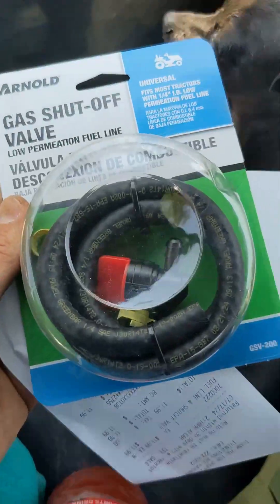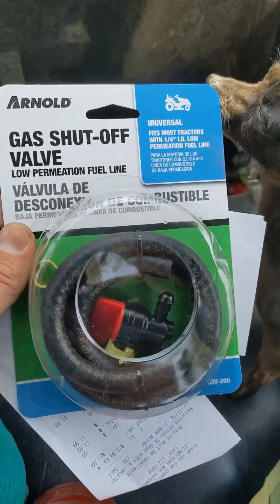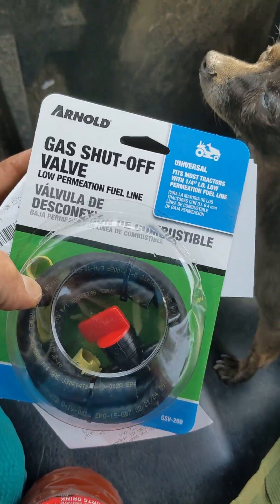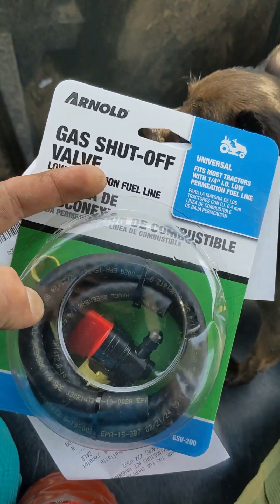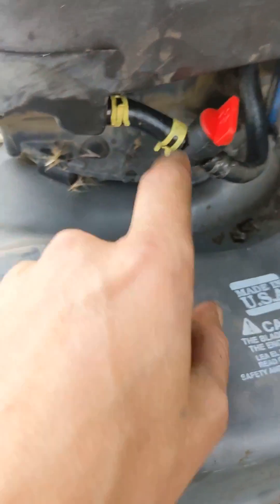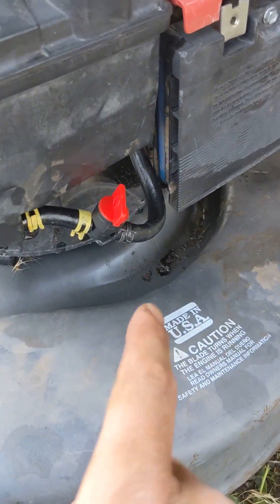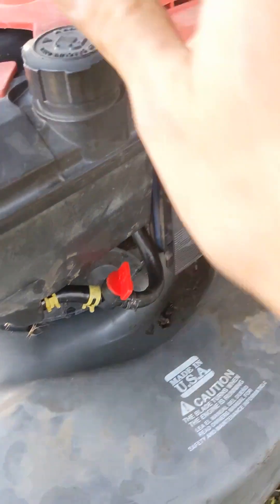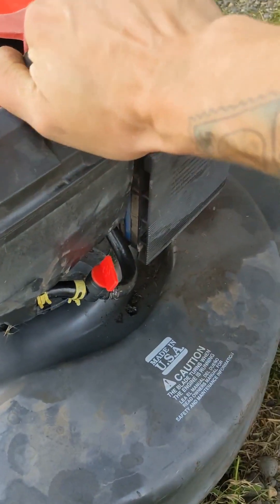I actually ran that lawnmower for quite a bit and mowed some. But when I ran out of gas and went to fill it back up, I don't have any leaks, but the carburetor for some reason is just running gas right into it — it's flooding out. So I bought this stopcock here. I'm going to cut this line at the house and add the stopcock in the middle so we can control the fuel flow. I just added the stopcock in between, cutting a little more line so we can turn the fuel off. We're not leaking from the bulb or the line — it's just running through the carburetor. This will let us turn it off so it won't flood, and then we should be able to get it to run.